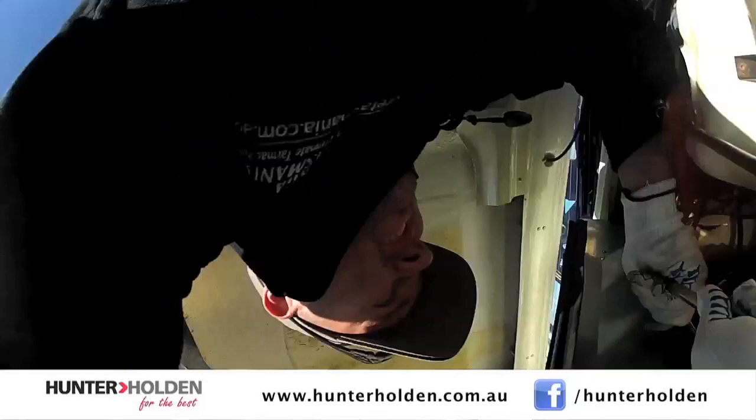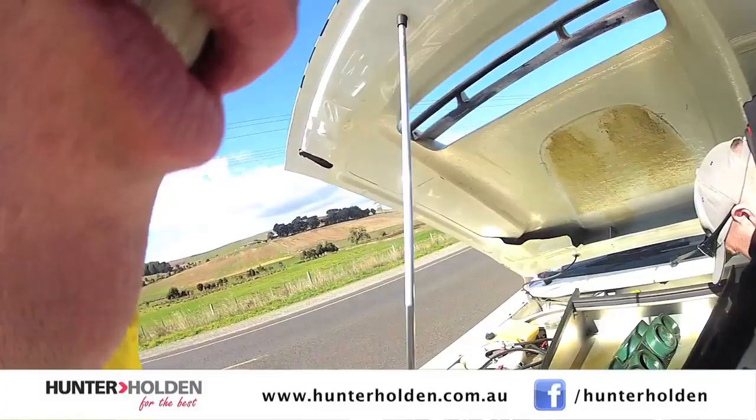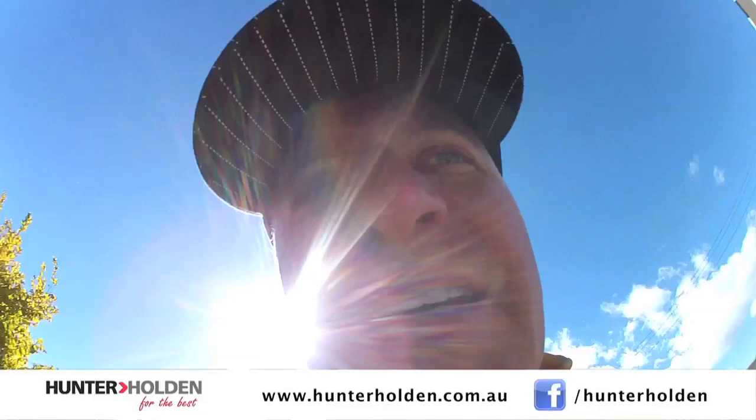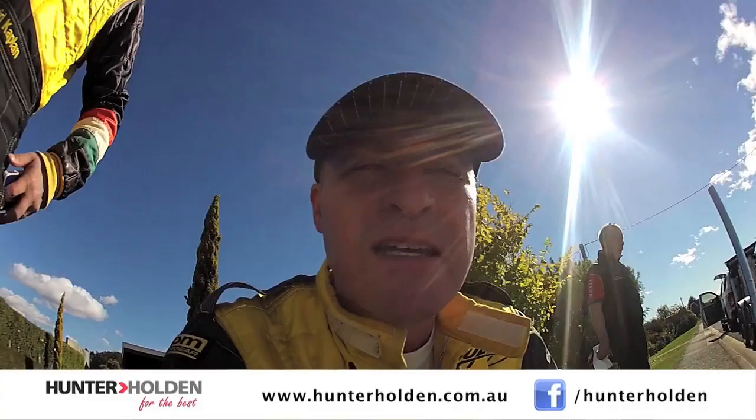A good man is in there and working. I'm quite sure he'll tell me to fuck off in a minute because I'm in his way. It looks like we're absolutely blessed — the top of the rocker has broken off, and we just have to pray the pushrod isn't bent. We don't need pushrods — isn't this an overhead cam? I thought we were cheating. Here's the culprit — that little bit there should be on that little bit there. Just waiting to see if we've got a bent pushrod, and if not, we should be in order. Pushrod looks straight — I reckon that's close enough for Targa. We can afford to lose a few horsepower. Let's see if we can glue this back together now.